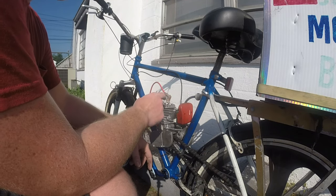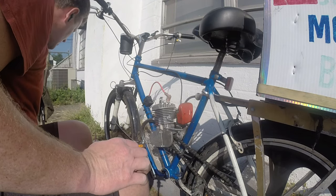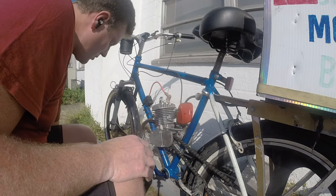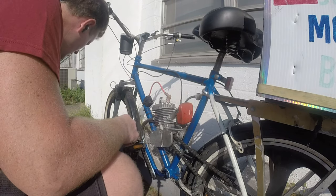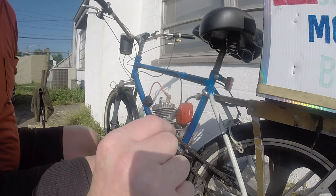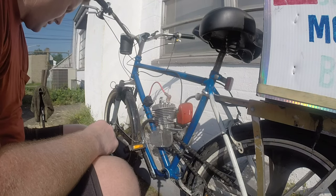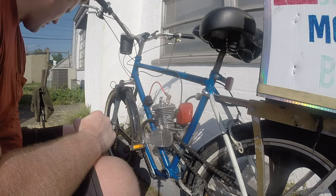And with the red and black one, I know you guys are interested, I measured all the timing. Stupid enough, I didn't measure the timing after I changed the piston. The blowdown was 31 degrees and I wanted a little bit less blowdown. I like more torque because of where I ride. So I wanted a little bit torquier motor. So what I did is I ramped the piston about half a millimeter to a millimeter into the transfers to get the blowdown percentage less. So all the better, right?